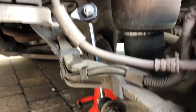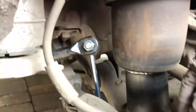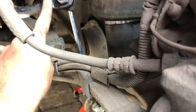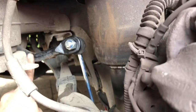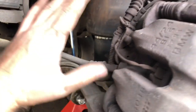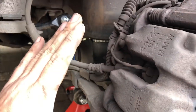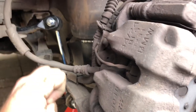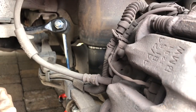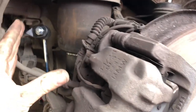I've already done one side — the only shiny bit there is this rod here. For those that don't know, this bar here is a torsion bar which runs from this side of the car all the way across to the other, joining the two suspension setups on the two rear wheels. You have it at the front as well, so when the body rolls one side it pulls down on this side and pulls the other side down equally, so you don't get massive body roll going around corners.